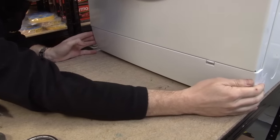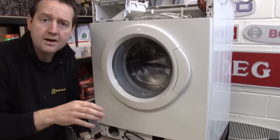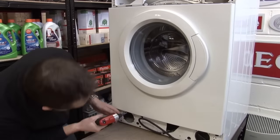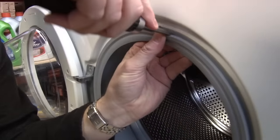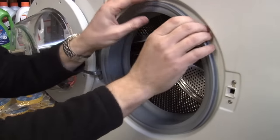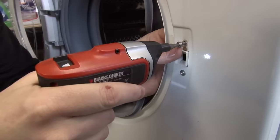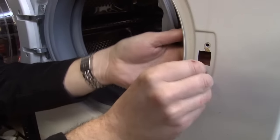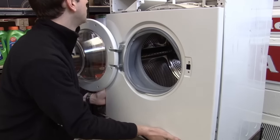Next the kick plate or plinth — that should just come away. Take that drain hose off. Now you should just have probably four screws holding the front panel on. I'm going to remove the seal from the front panel. This one has a spring and a retaining band — they vary a little bit by make and model, but it should just pull away, and then the seal comes away. That's going to allow me to get at the door interlock, and that should mean I can lift the whole front panel away.